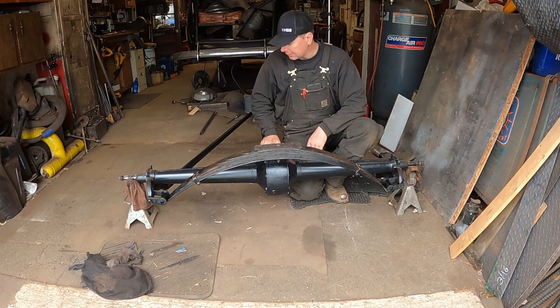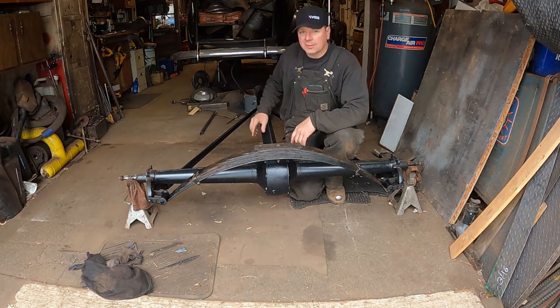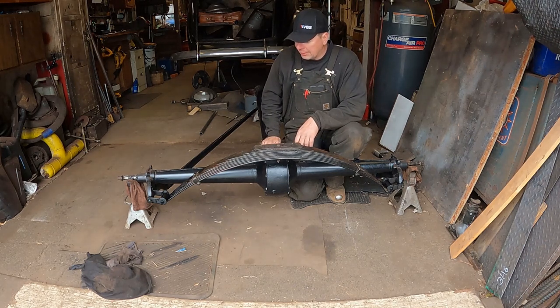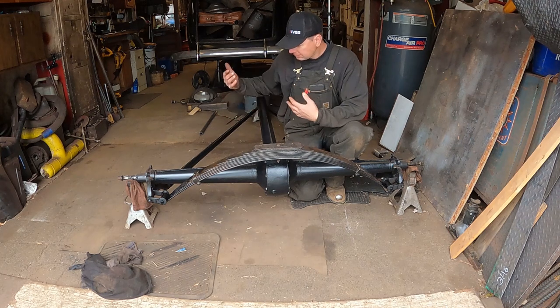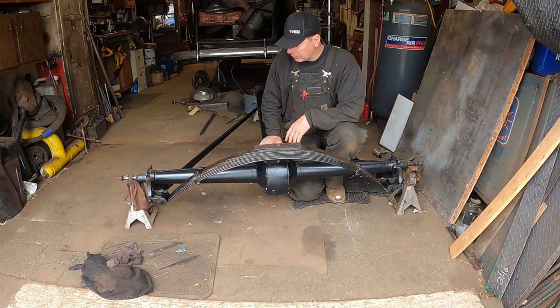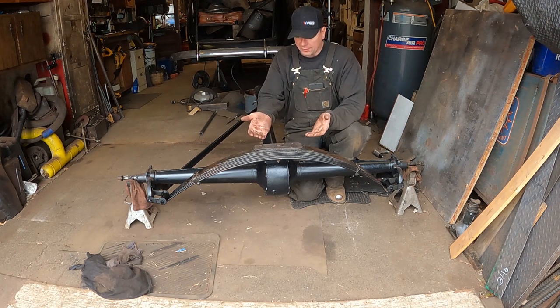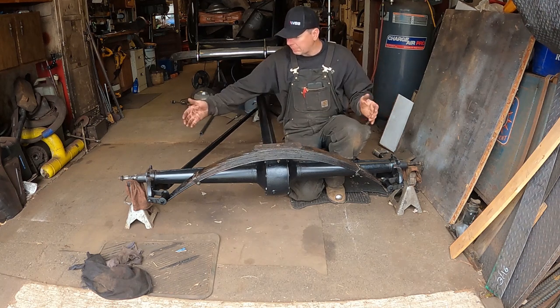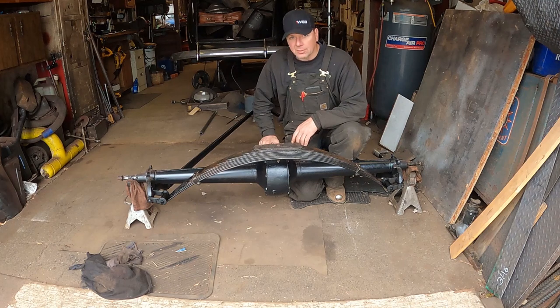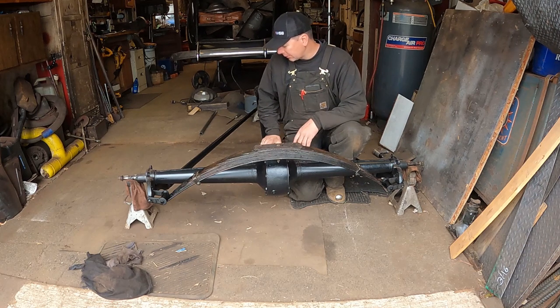Bam. And next time, I'm going to be taking this rear end and Kirk, we're going to put it back in the car. I've got to put the gas tank in the car there first, the '35 Ford gas tank that I'm using. I'm going to slap that up in there, and we'll slide the rear end up in, get it jacked into place, get the front clamshell piece for the torque tube, we'll get that in, we'll bolt the rear end up to the transmission, then jack this up, relocate the spring in the crossmember, get that in there, and then I can put the brakes back on, put the hubs back on, and eventually we'll set the car down and see. I'm hoping it's going to have about a 3-inch rake backwards, like a late 40s custom or mid 40s custom Taildragger setup, so I'm really excited, and I think it's going to work out just fine.